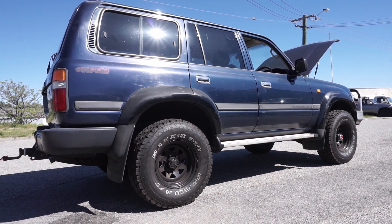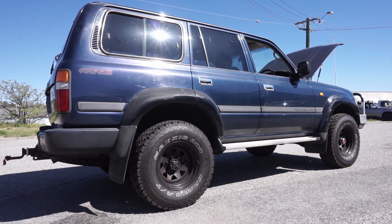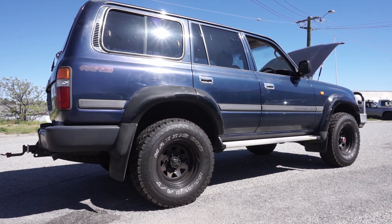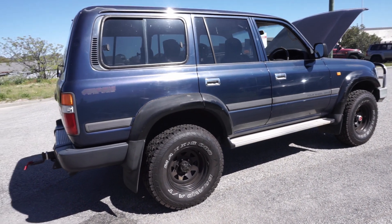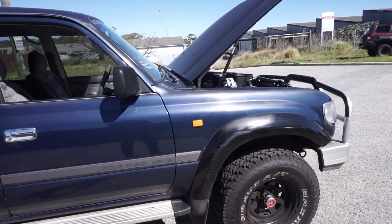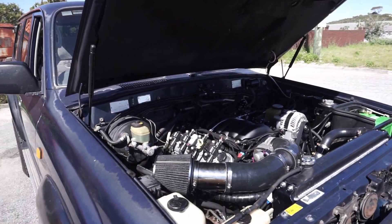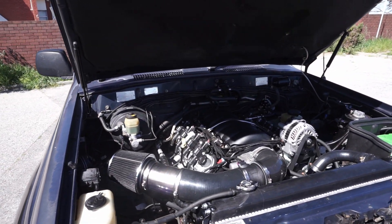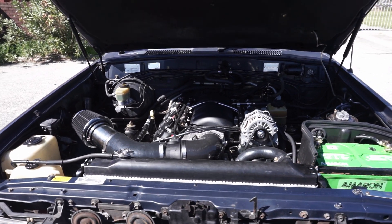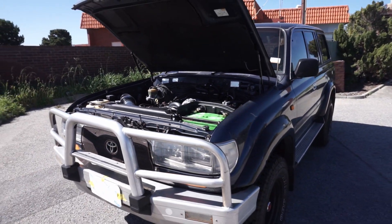Both of these are finished up now and ready to give back to the customers — I'm sure they'll both be pretty happy. If I was going to have one, I'd definitely have the 6-speed auto. Really nice having those short ratios — great for towing and just generally driving around. They're also quite a strong gearbox; we regularly put 500-600 horsepower through them with no problem. Next up will be a GU LSA 6L90 combo, so make sure you subscribe and stick around for that. Thanks for watching.